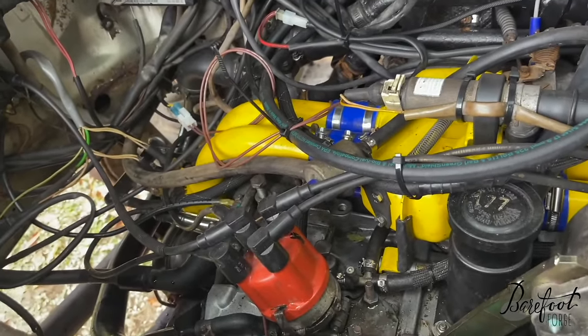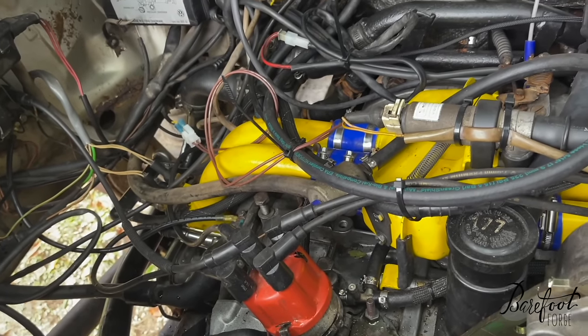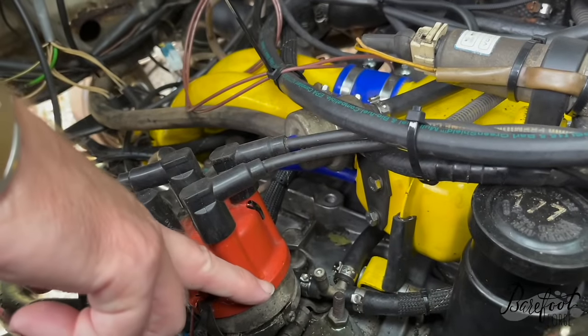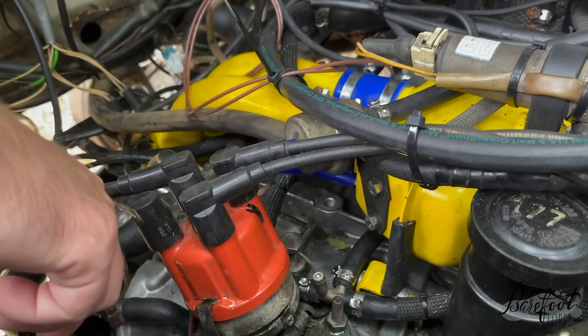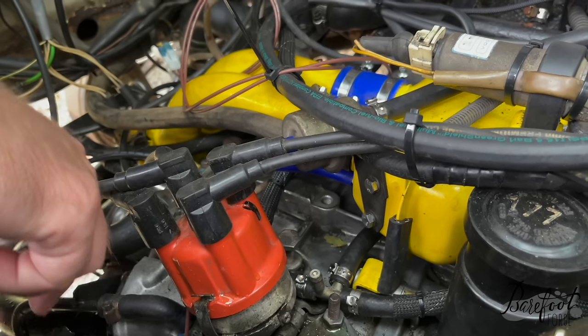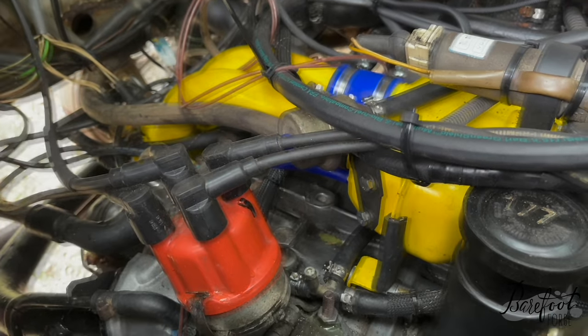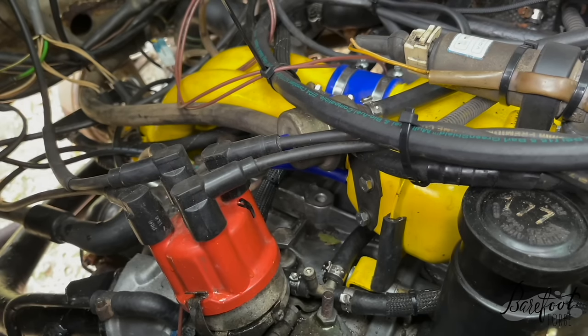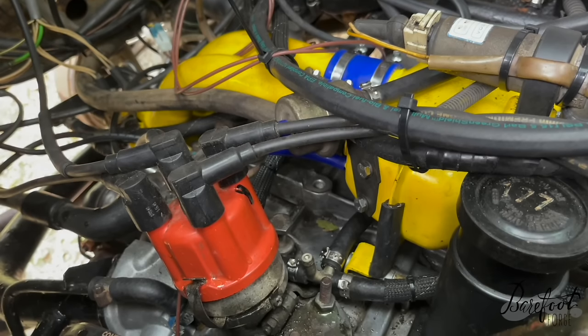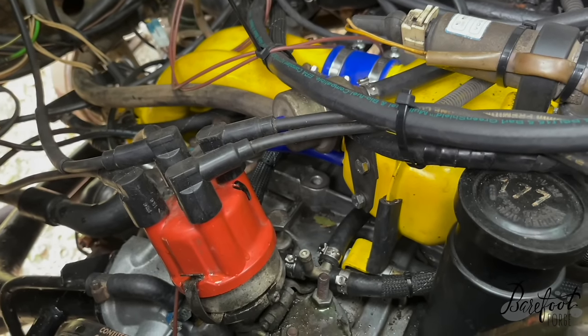Where's the key? You have a key. It's in my pocket. Everyone has a key. How many times? Okay, go on again. Go off. Go on again. We've got fuel pump, we're hearing it, but no pressure yet. No. It's flipped. Yeah, well, that sucks because I wired those terminals in, and they're the only set I have. Okay. Go backwards. Off. We didn't know which was which, so we just have to pop the two fuel hoses off. That's why we left them long, and we'll be good.